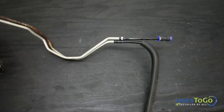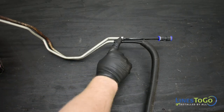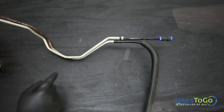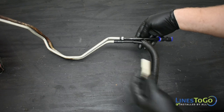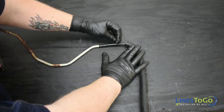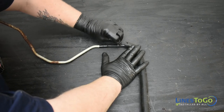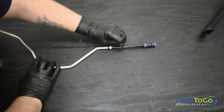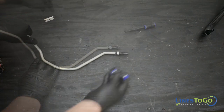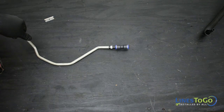This set of lines reuses the nylon vapor hose from your original lines. Line up the old and new lines and mark them both on a straight section on the nylon. Cut both lines using a sharp razor blade. Install the connector onto the new line. The original nylon hose will be installed into the connection later.